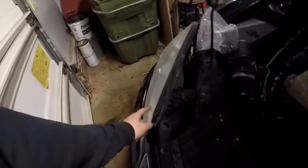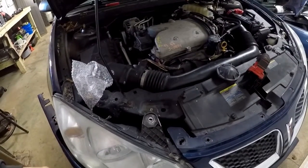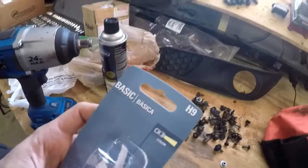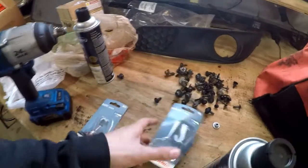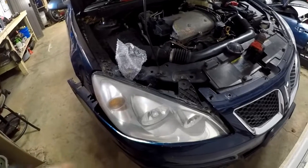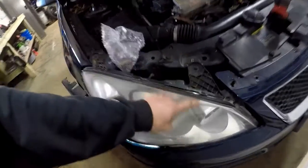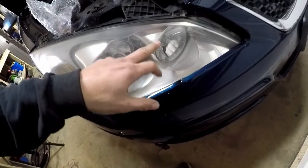Let's get started with this front headlight. I put a new light in and it's still not working. I did go get the correct size - H9 - but my light still doesn't work. I'm going to have to pull probably this half of the bumper off and look at the wiring, because we do get the running light and the high beams, so there's got to be something with the wiring to the low beams. I may check the fuse to see if it's blown.